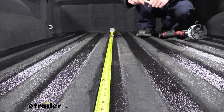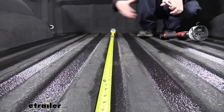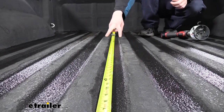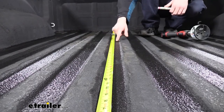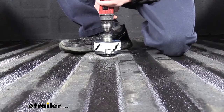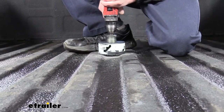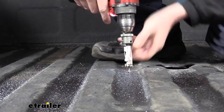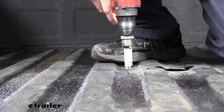The second mark is pretty non-traditional. Typically for a gooseneck you'd have a side release handle, but due to the way the fender liners are on this truck, there's no side release handle. Instead, it's going to be an in-bed release mechanism right here. In order to access that mechanism, we do have to cut out a small hole. So now we'll take our hole saw, start with the larger 4-inch hole and drill it out, then move on to the other hole using a 3/4-inch hole saw.